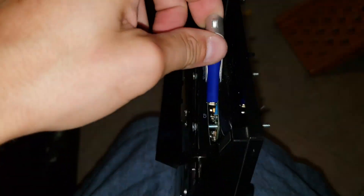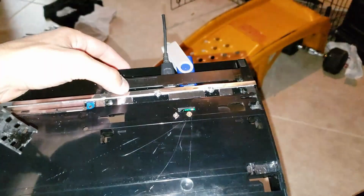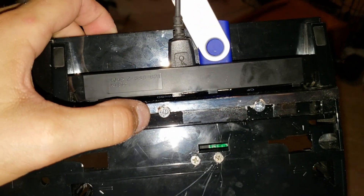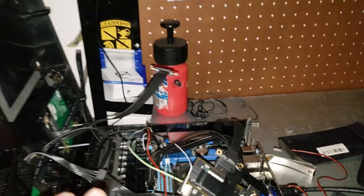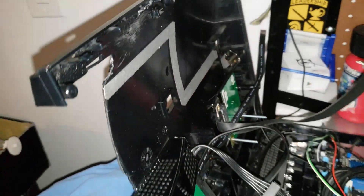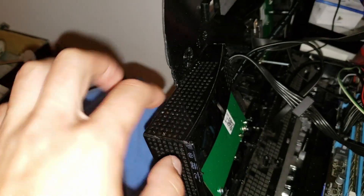USBs work — let me just unplug one to show you guys. Now let's finish the rest with the chrome trim. We used the Dremel to drill out the edges of the small plastic chrome trim piece — I cracked it slightly, but other than that it's pretty much flawless. We're going to put everything together with the screws. Now we'll get the network card, the wireless one, and 3M tape it in place so it's easy to remove whenever we need it. 3M tape is also holding the SSD and hard drive in.